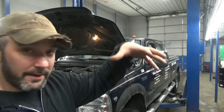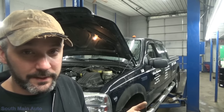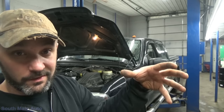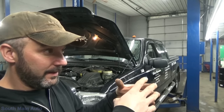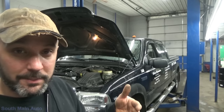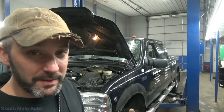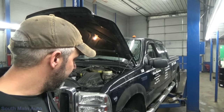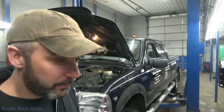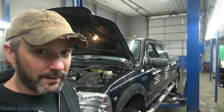There's a vacuum line going to the actual steering knuckle, so you have a potential for a leak in the wheel bearing assembly, a leak in the actual lockout hub assembly, or a leak in the big seal that goes back there that seals on the axle shaft by the wheel-end U-joint. There's a lot of potential for a leak and a lot of moving mechanism there, so obviously a lot of failure points. Before we get too far into it, a visual inspection can nab these quite a bit.